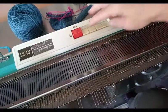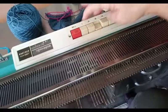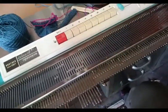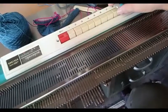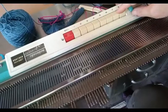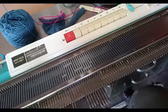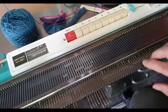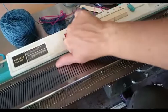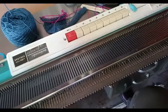By the way, if your buttons aren't staying fully depressed and popping nicely up and down like these are, usually the mechanism is not broken. Usually it's dirty and sluggish under there — could be old grease, could be some fuzz, could even be a little bit of rust that you have to clean out. We made a video on going in there and doing that to a machine that wasn't working as nicely as this one, and by the time it left it was working just beautifully.